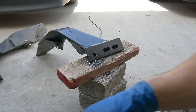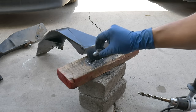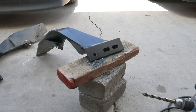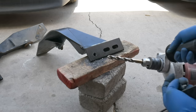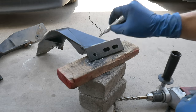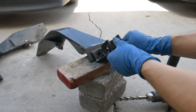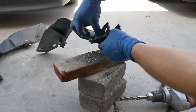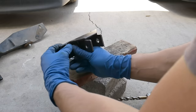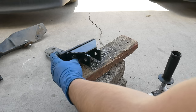After you've got the hole drilled, go ahead and test fit it. I want to make sure I used a large enough drill bit that would fit the bolt without having to enlarge it anymore. This one is made for metal and it has the pilot point, which is why I used it — when you push it down it makes a little mark which allows that pilot point to stay right on it. It came out nice and clean. Just want to make sure these both fit — that one's good, it's perfect where I drilled them. This is going to mount just like that.